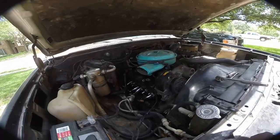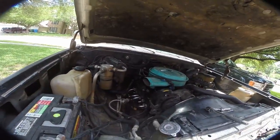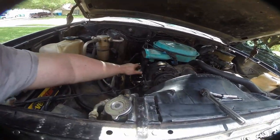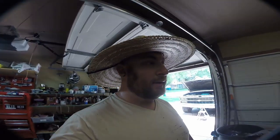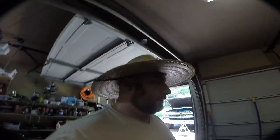There's the first header in. We're definitely going to have some trouble with spark plug wires, and I've got to find a new bolt since it's not really accessible anymore because of the way the header is designed. We've got one side of the exhaust in - the other side we're not going to put in yet because I still need to weld on that O2 bung and wait for it to come in.